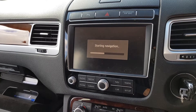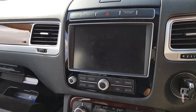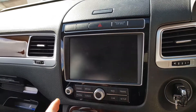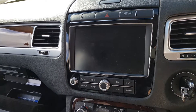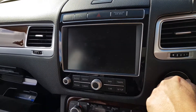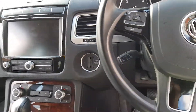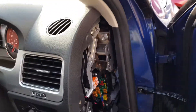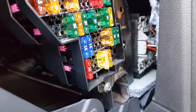When you actually power the thing on, it will power up and then just go blank, goes dead and stops — that's all it will do. Now what we've found is there's a fuse in this side fuse box. That 20 amp one at the bottom, fuse number 51 — that was blown.